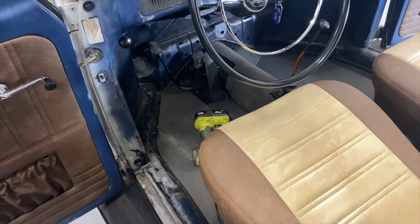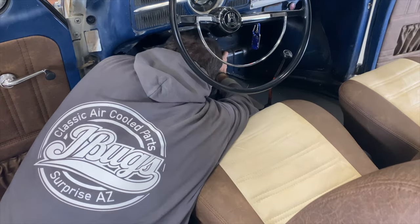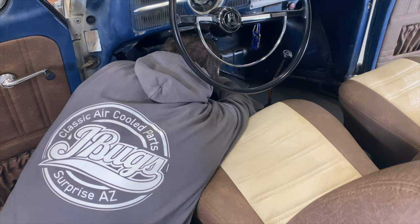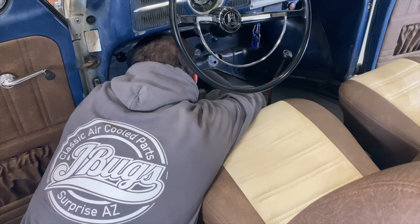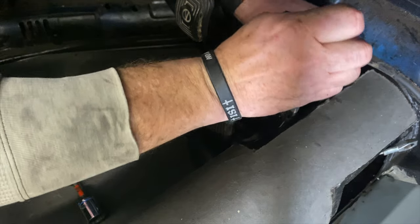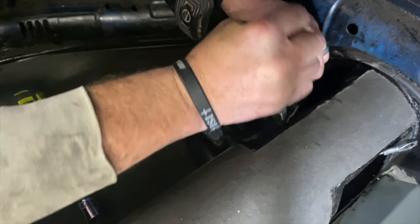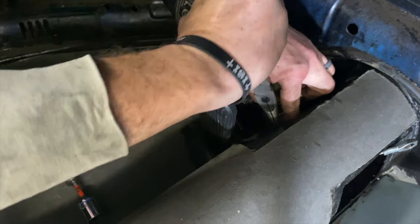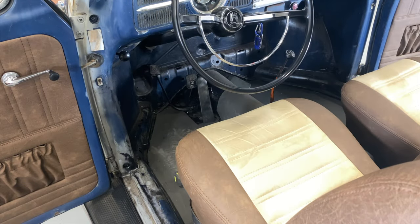I'll probably need some needle-nose pliers to get the throttle cable in — it came out much easier last time. I kicked the camera over, sorry. I was able to get the cable out of the old lever without disconnecting it from the carburetor, but I can't get it into the new lever without disconnecting it. So it's disconnected from the carburetor now. I'll also disconnect the spring to make it easier to work on, get some slack, and insert the cable. Needle-nose pliers help — there we go, beautiful. Let me go hook up the throttle cable at the carburetor.